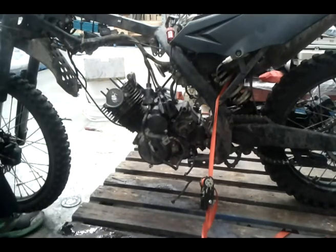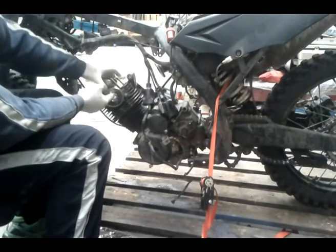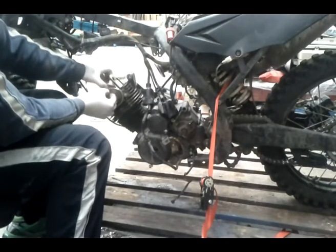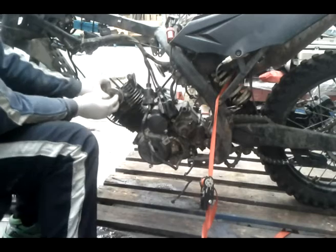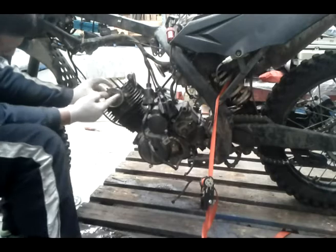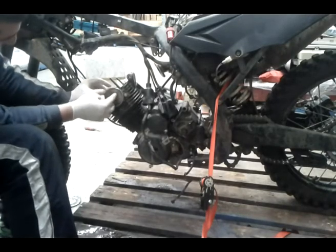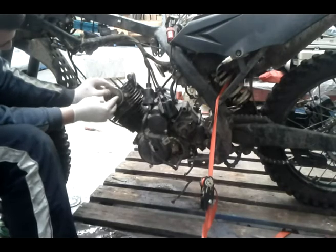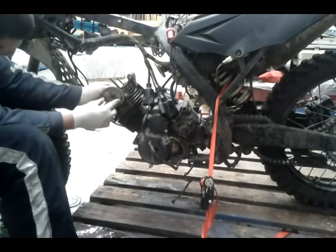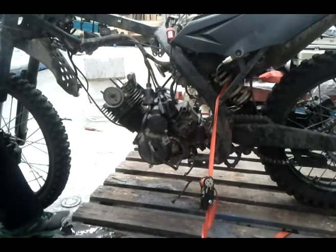Now, cam. Now also, if you don't have a pre-existing mark on your cam like this one, it's wise to mark it on which side. Draw a line straight through here to the cam. It should have one, but you should observe it in case it doesn't at the start before you pulled it apart. It helps line up all the, because there's two sides to the cam. If you put it on the wrong side, you'll wreck your valves.